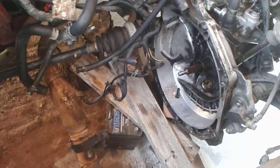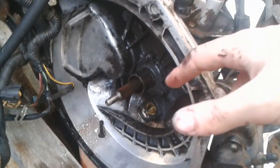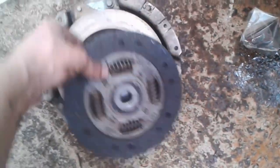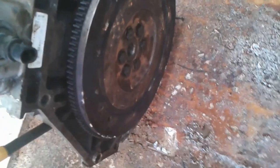This is the second day of working on this. When I removed the engine I noticed the gearbox leaking problem is located right at the output shaft seal, so I have to replace that before anything else. I'm now ready to drop the new engine in. I cleaned the clutch and the clutch disc and sanded it a little - still good for a few more miles. I put the flywheel from the car's original engine as it looks like it was replaced at some point and still looks like new.